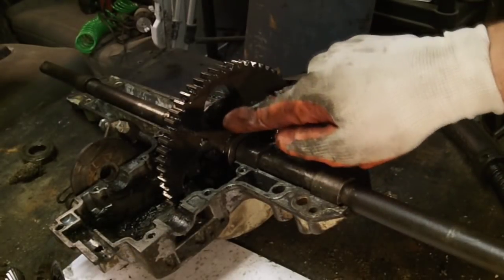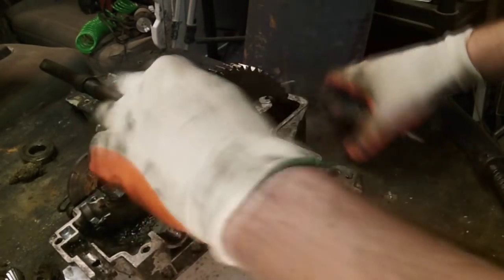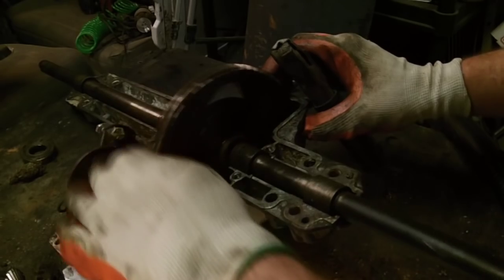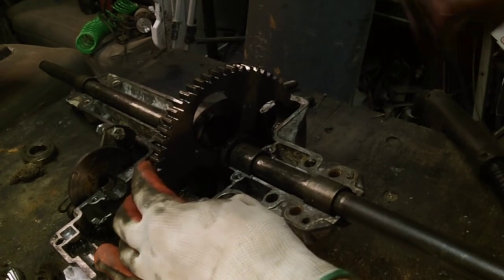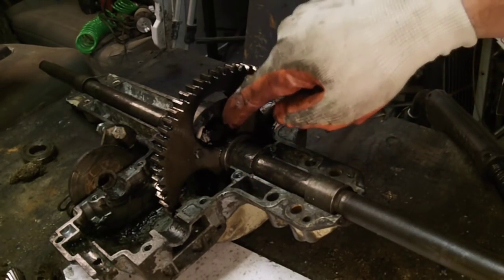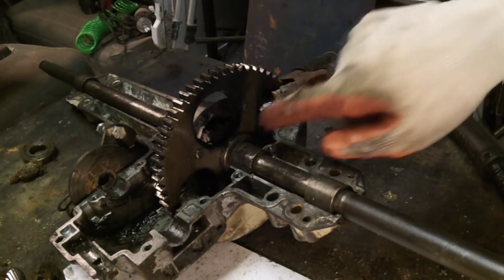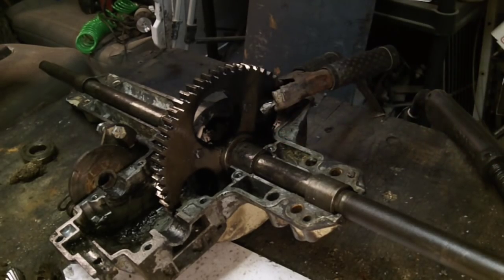Unfortunately in this one you actually can't see any of the gear or feel it. If I rotate it around, you can't in this one either. What I'm going to do — I don't know if you can see it in the video, but you can actually see where the gear going to the axle is right here. I'm going to weld that entirely solid across there, and then weld it up through and onto the side of this differential cover.